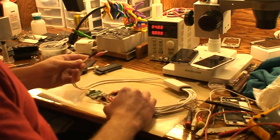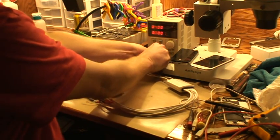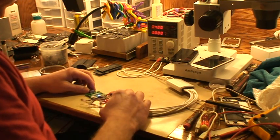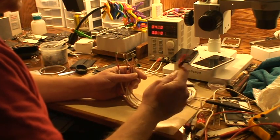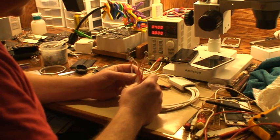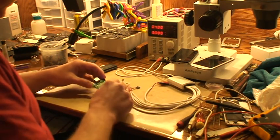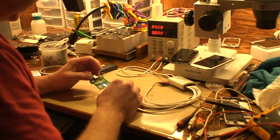What it's designed to do is hook it up to your DC power supply. I've got it set to 4 volts right now, which normally when you're charging a phone, you're looking at 3.7 volts for the batteries, but they generally say 4 volts when fully charged. It comes with a set of jumpers you can use for anything, leads to hook up to the motherboards of an iPhone 4, 4S, 5, 5S, 6, and 6 Plus. It also comes with a board to charge batteries directly from the DC power supply, which is really convenient.